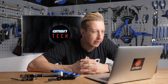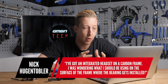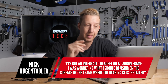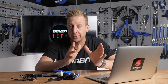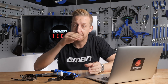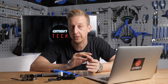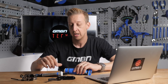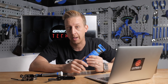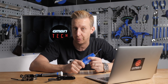Next up is from Nick Hugentobler: "I've got an integrated headset on a carbon frame. I was wondering what I should be using on the surface of the frame where the bearing gets installed - grease or carbon paste?" Presuming the frame itself has a bearing surface already part of it and the bearing sits onto that surface, you definitely do not want to use any assembly compound or carbon paste. It's basically a grease format but with floating particles - gritty stuff - and you do not want that anywhere near your bearings.